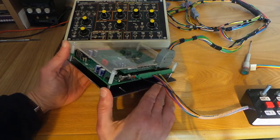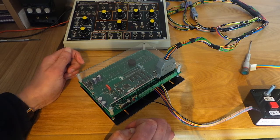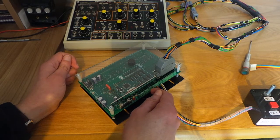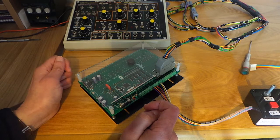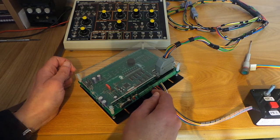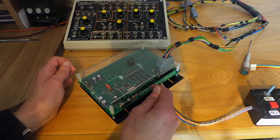Of the essential signals, we have a speaker on board used to generate audio warning tones. You can either use the on-board speaker — in which case put a small link between pins 26 and 27 of the terminal blocks — or use an external speaker. There are no speaker connections on the D-type connector, as this was introduced only on the most recent versions of the module. For an external speaker, make sure it's an 8-ohm impedance speaker, remove the link, and connect the high side to pin 26 and the low side to pin 28.